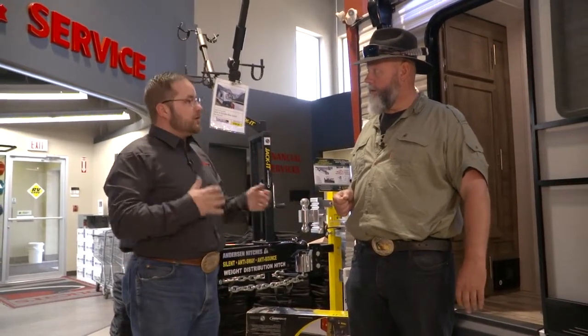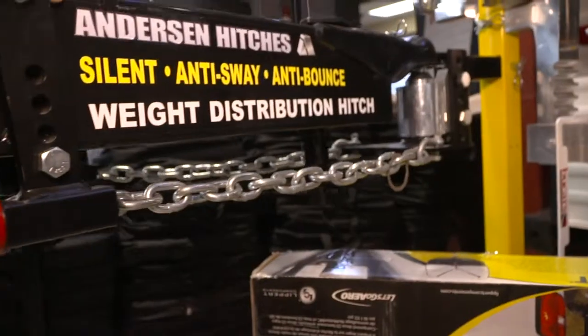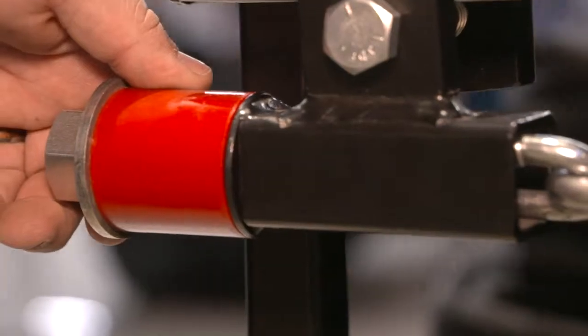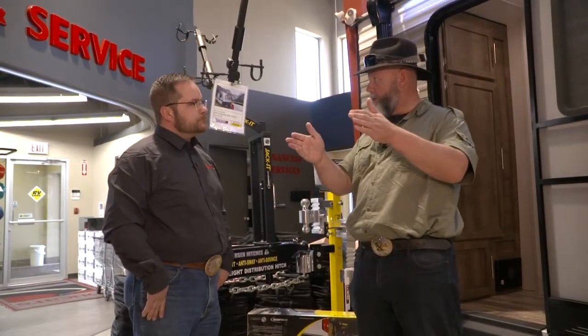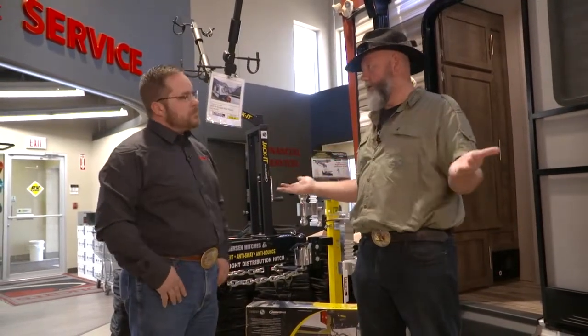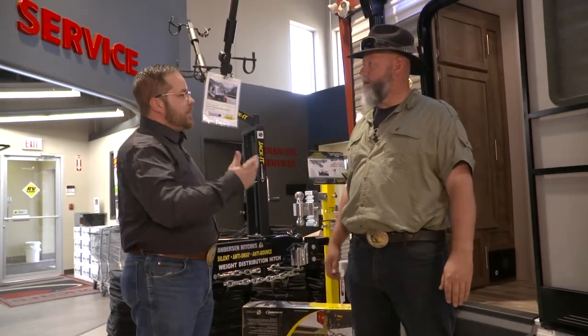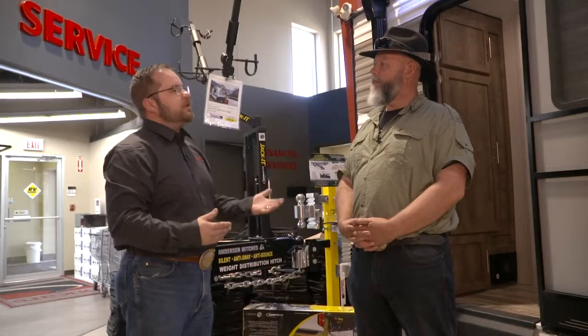That back end is just going to kick everywhere. That's what's called sway control, and a lot of people get them confused. In the old days they'd say don't pack stuff in the back of the trailer because that puts too much weight in and you're guaranteed to get sway. Also when you've got strong wind, the trailer is more inclined to sway because of the wind resistance. Back in the day we used to have the axles further back, but now with bigger, heavier trailers the axles have moved ahead and that's why we get all the sway.